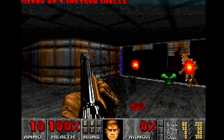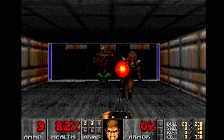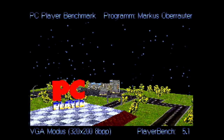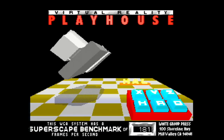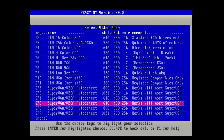The integer performance is much better now too due to the doubled CPU clock. However, the video performance only increased slightly to 3.0 from 2.9. In Doom we now get 10 frames — still a slideshow and not playable. PCPlayer and 3DBench show performance increases of 40 to 60%, not far from the promised 70%. But for gaming, going from 3.2 to 5.1 frames in PCPlayer is still very slow. However, for math-intensive software and floating point work, the difference is dramatic: FractInt took 44 minutes on the SX20, while the overdrive finishes it in just 53 seconds — more than 50 times faster.